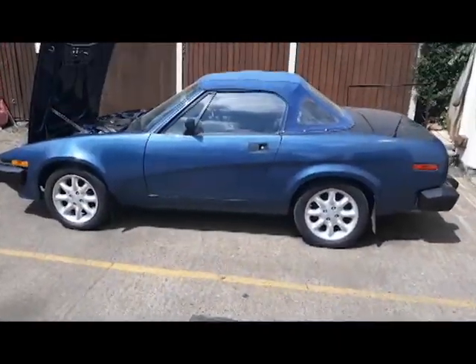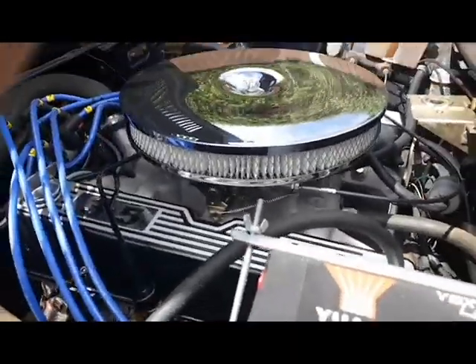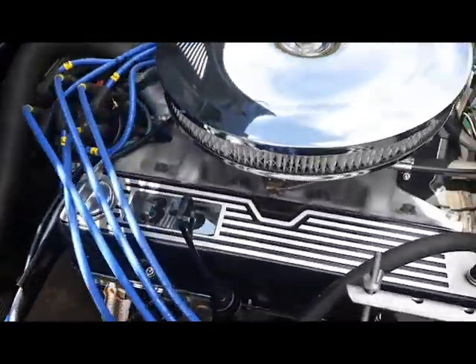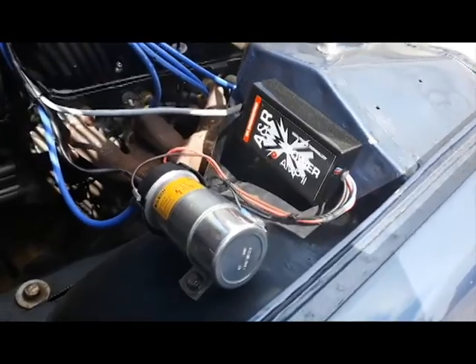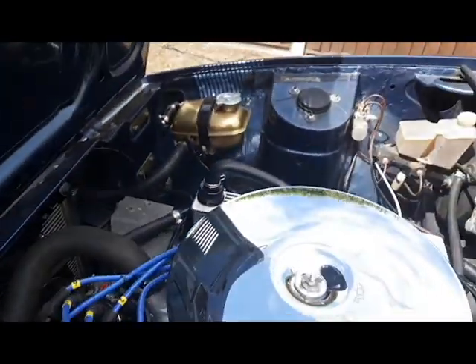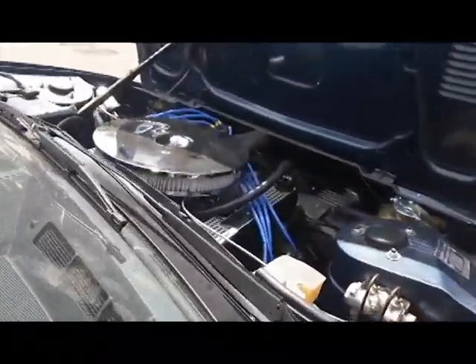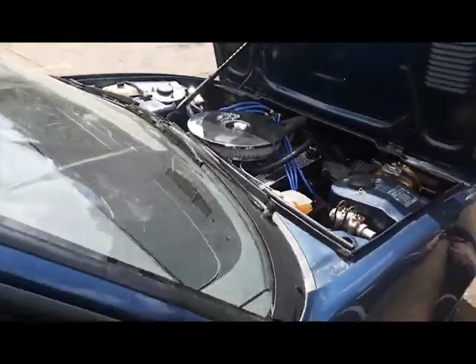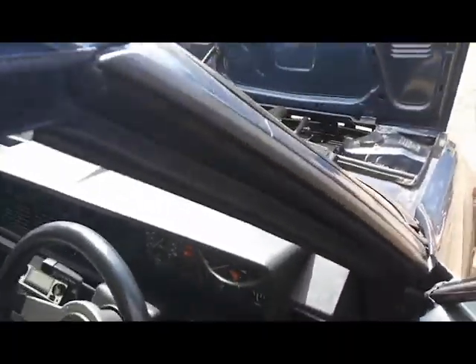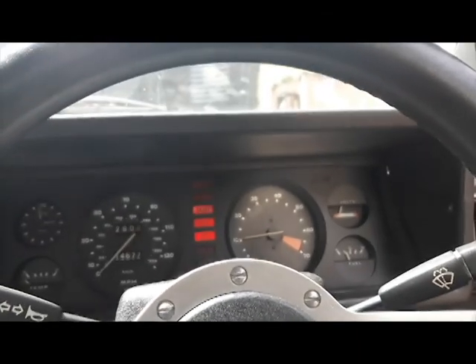Last little section — the TR7-8. It's now got the Weber carburetor, or Edelbrock, installed on the Offenhauser dual port intake manifold with an RPI ignition kit. The coil has been relocated onto the wing by the RPI amplifier. It's been a really nice smooth job this one — the camshaft was in good condition so the engine was suitable for all this work. She's running really nicely. Yet to go up the road in it — I'll be doing that on Monday and we'll do a little video for you all. The engine isn't cold — it has been running for a couple of minutes.